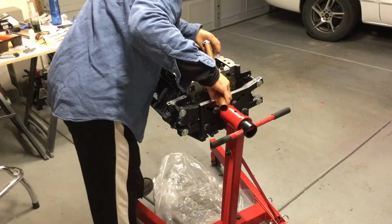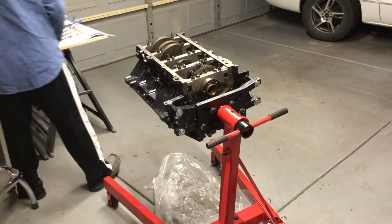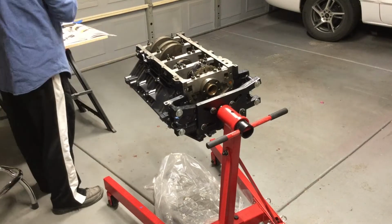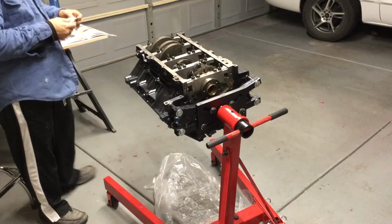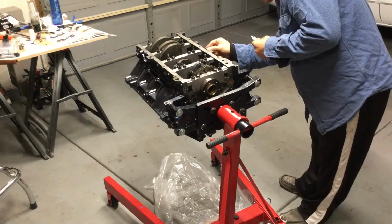Also, when you're torquing, they give you a certain foot-pound specification, and then I'm actually using an angle meter. They'll say, okay, go up to 45 pounds of pressure and then do 90 more degrees, or 45 more degrees, or whatever that specification is. So certain cases might have been like 60 degrees, and so I actually had to use an angle meter and start torquing that thing a percentage of degrees.